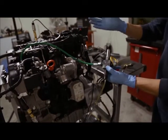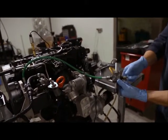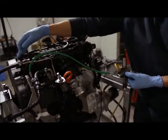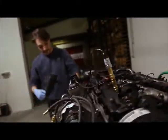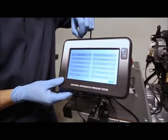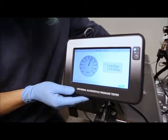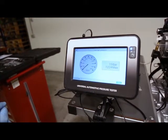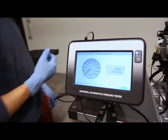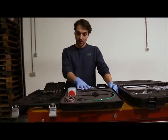If we want we can make the engine run — of course here the engine won't run because we don't feed it with fuel, but if we connect the second hose from here to the common rail we can make the engine run. So let's go back to the screen. I'm connecting the sensor — fuel high pressure. We have what I'd say is a normal pressure. If the second hose were connected you would have a running pressure of around 300 bars. These three sets are for diesel common rail only; the gasoline common rail adapters will come very soon.